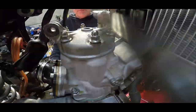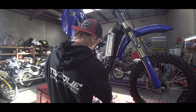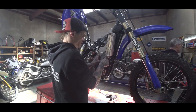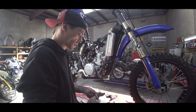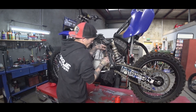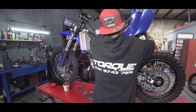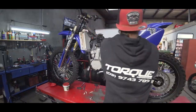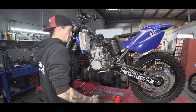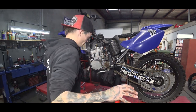Head's on — put a little bit of grease on all six of the studs, grab the stud caps. Now we'll tighten up those six bolts — that clicker you can hear is the tension being right, sounds pretty good. Put this lever back on and close this side of the motor up, then it's done and complete. Get your carby sitting into this manifold first, do that rubber boot — you'll feel it sit back into a position where it feels right. It's in, done, good to go.